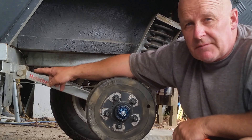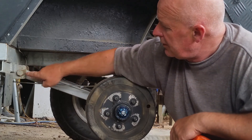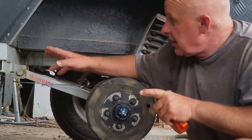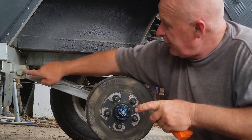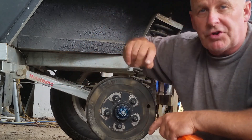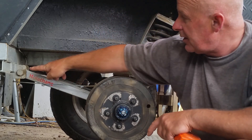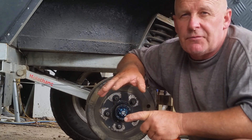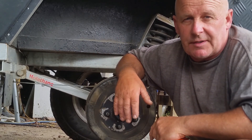The mounting points that the suspension pivots from are made from 5 millimetre plate, which is 3/16ths. The bolts are 16 millimetre high tensile bolts, that's 5/8ths. I've left enough room around the heads so that if this ever takes a big tweak and needs to be adjusted back into spec, I'll be able to drill the holes out to oversize, weld a small piece on, and put an eccentric washer in to get toe-in, toe-out and camber adjustment — just like the more expensive ones.